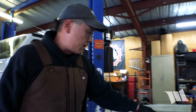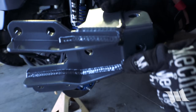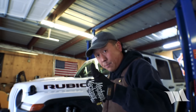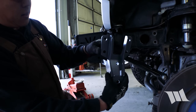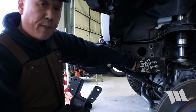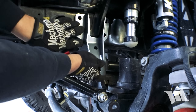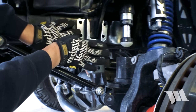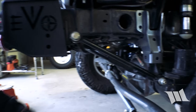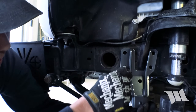Alright, I think now we can go ahead and grab the Synergy bracket, which looks really nice, I might add. Look at these welds — they're so nice. Made in the USA right there. Good job, Synergy. You can clearly see that this is the outside of the bracket. We're going to go ahead and slip it up and over the factory track bar mount. You can see how much more of a reinforcement bracket this really is going to be. We're going to grab one of the longer bolts that we removed from out front and use that to get things started.